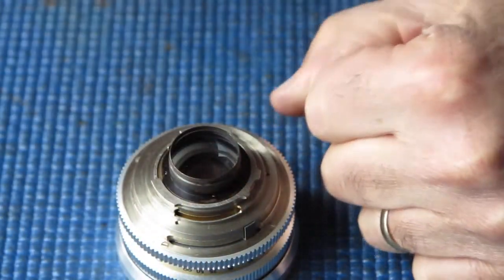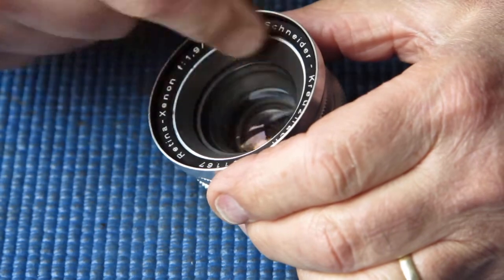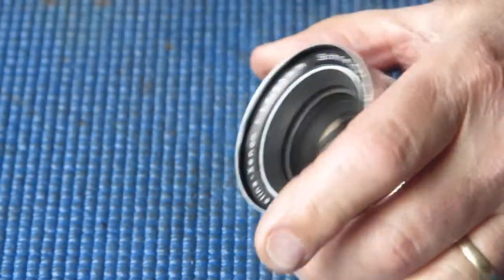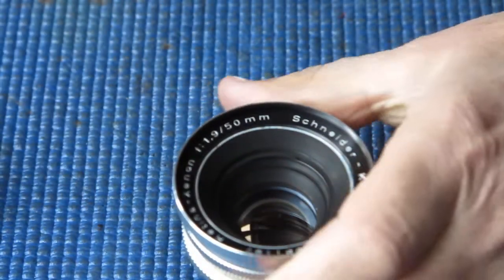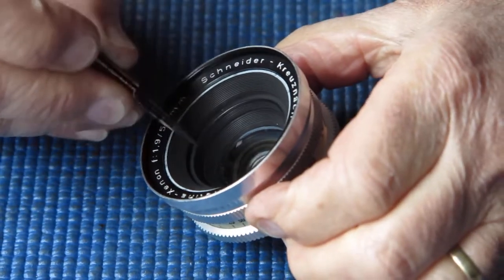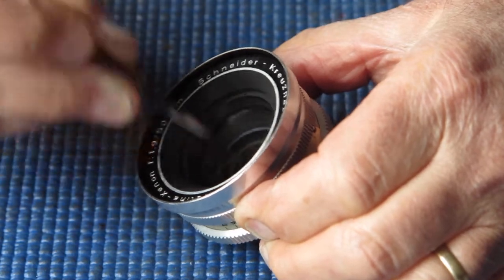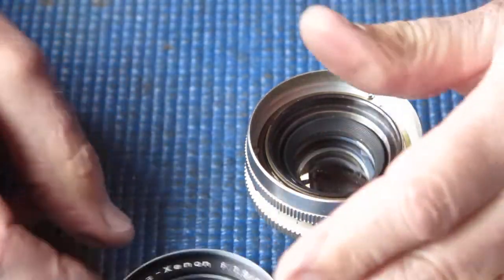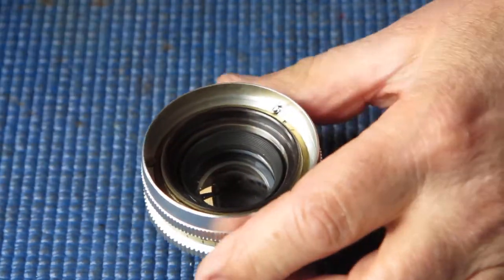So what do I need to get in? First of all I want to remove the lens capsule from the mount. I need a friction tool - get it on that inside cone there, unscrew that and take the filter mount off the front. I'll use the tip of my tweezers very carefully because I don't want to scratch anything. The filter mount comes off the front. Having a quick look at that - it doesn't show any drop marks, which is fairly unusual; they often do.